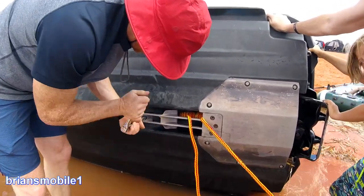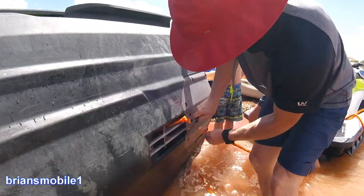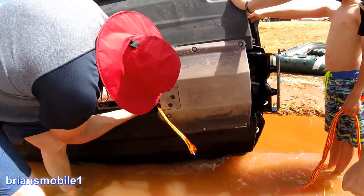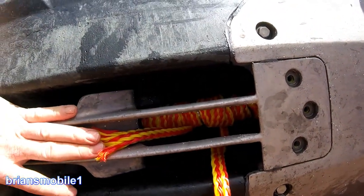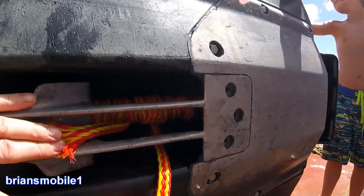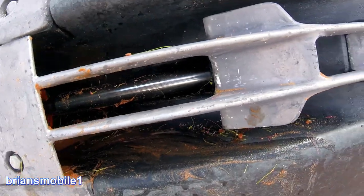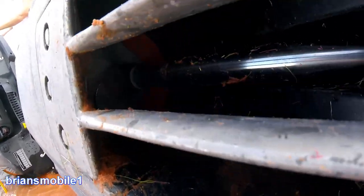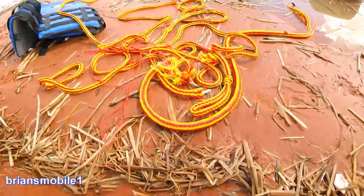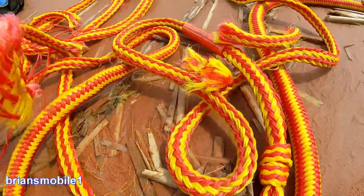Let's show you how to get the thing undone. The impeller is spinning — it won't come out. Another thing we can do is just unwrap it through the hole. Sometimes the best you can do is use your fingers, and on some watercraft that's enough. It's jammed up in there — that's what made it stop. So we're going to unravel this first, then push it to where we can unwrap the rest of it. We've got this one cleared out. The hardest part is where it narrows down. If you can get that cleared or push it into where it's loose, the rest isn't too bad. You can see the impeller in there — it's all clear, but there are a lot of little rope pieces on the beach now. We used a fillet knife to go across the top of the shaft, and that's where these came from.